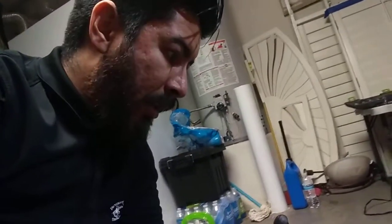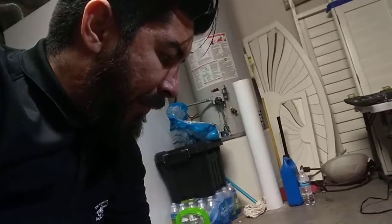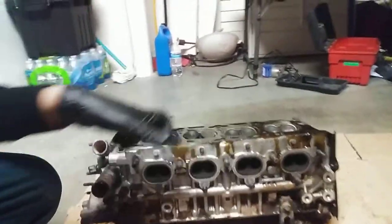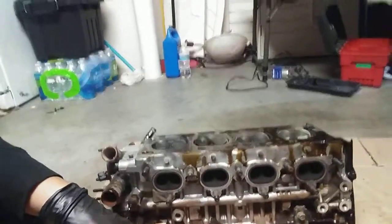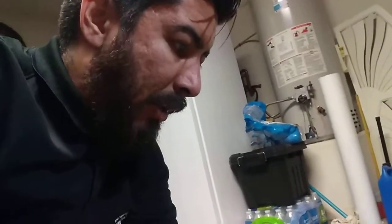So I will do that. It's a pain to do, it's just tedious little work here and there. You pretty much measure just the insides. But I would still get it decked — that's what I'm going to do anyway. Get the new gasket on there, torque it down, call it good.